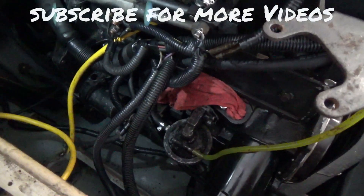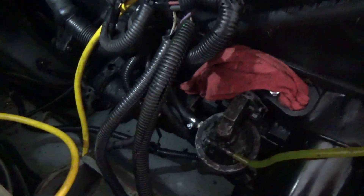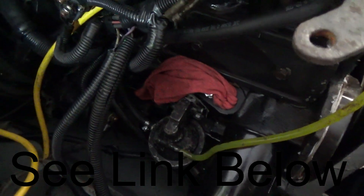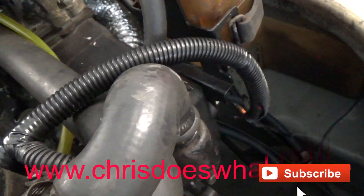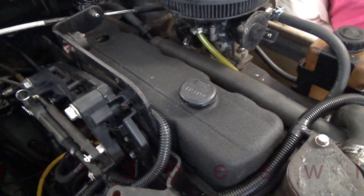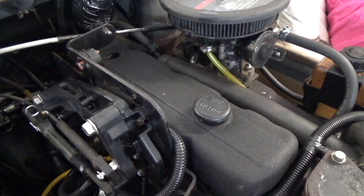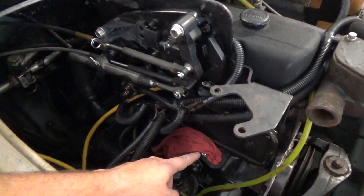Okay, so got the wiring harness wired up correctly. You can see the rubber hoses — there are of course some pieces missing, the distributor's gone. I filled that hole with a rag because I don't want critters getting in there. We wired across the top all the way to where the alternator is going to go. The previous owner apparently doesn't like chokes, so they cut that one off — that's the red and purple wire. Next, we're gonna stab the distributor.